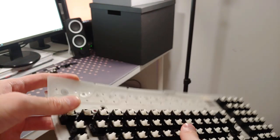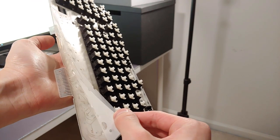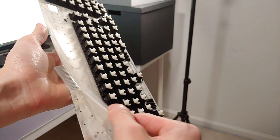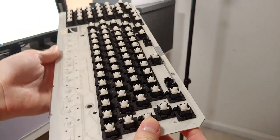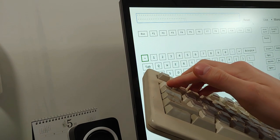So you will probably slow down towards the end of the keystroke where you're met with making contact with the membrane sheets. These are several sheets of plastic film where the actuation happens, and they absorb a lot of the bottom-out impact. If you really slam on the keys, you will hear a familiar clack, but in a typical typing scenario, it's about as quiet as Cherry MX Silent. With the coil spring removed, this is much more evident, but not all is lost.